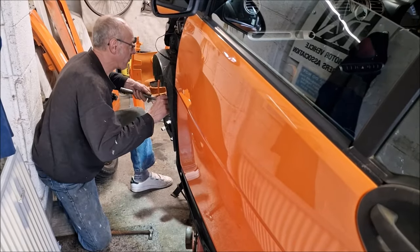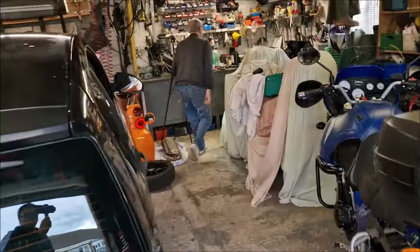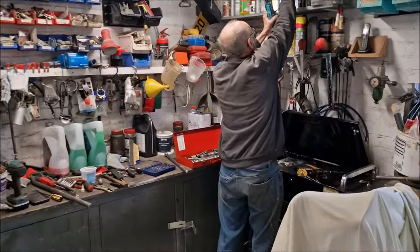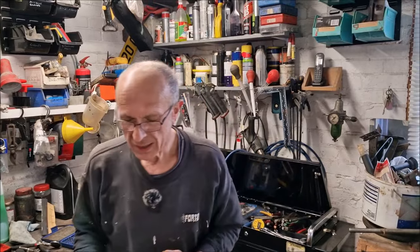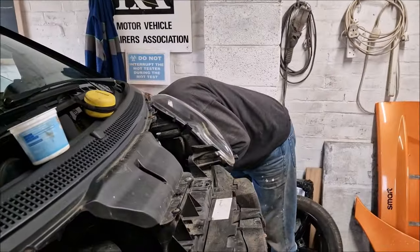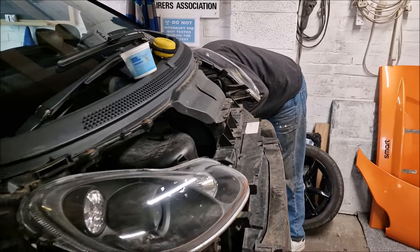The brake inspector is here. So the front brakes need stripping and easing, but they're not what's causing us issues with the brake pedal, right? No. What are you going to do on there? Just put some lubricant on it. Is that a big bottle of Red X? Yeah, it's a carburettor one. You could have a theory that it's never been bled properly because the bleed nipples are a bit stuck. I'm going to put a bit of soak on and let them soak.